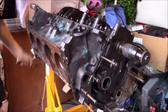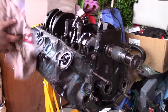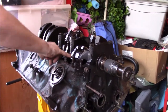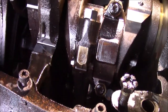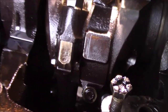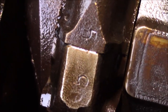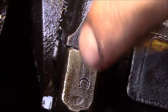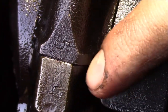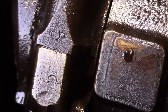A lot of these pistons are already indexed. If you don't know what indexing a piston is — take a look right here. I'm looking at the five right here. That right there is five and five, so we know that this piston goes in cylinder number five. These two pieces are what we want to match up. These aren't fractured, but in some vehicles these will be like a small fracture, and you want those to match up because they won't match up with any other piston.